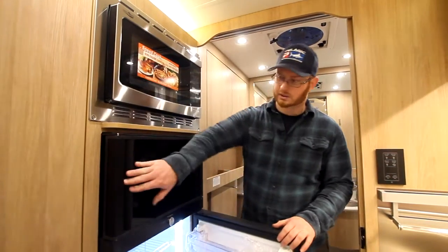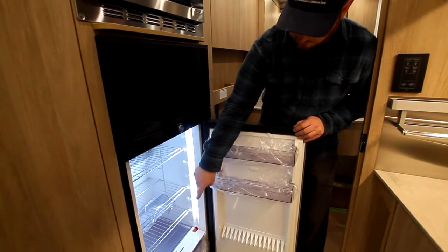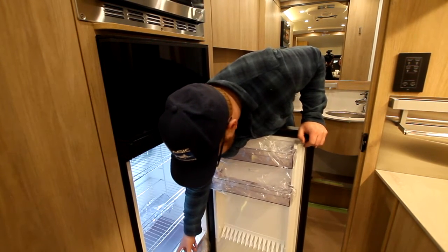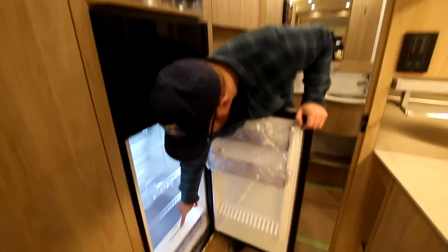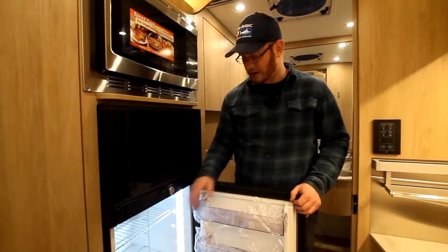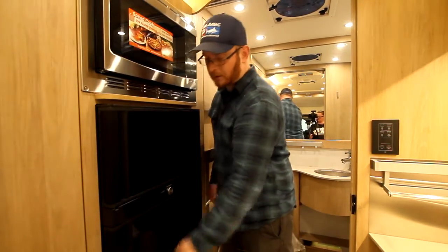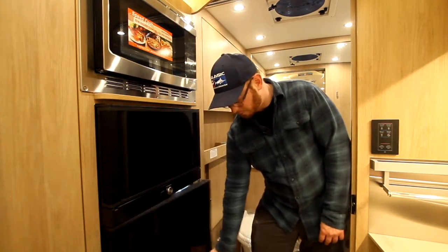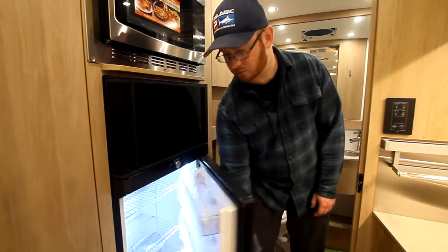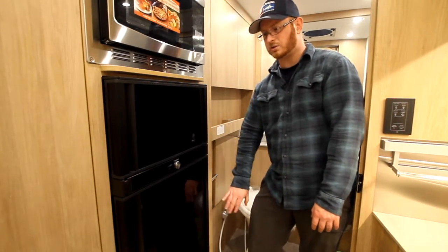You can see that I have the system on. You do have light indicators in it. You do have your fresh food selector down there, so you can control how much airflow gets into the unit right here. If you have pears, you want less airflow; if you have apples, you want a little bit more airflow. When pressing and opening this, you want to pull from the center and close from the center of the handle as well. That helps secure the top and bottom latches all the time. If you pull just from the top, you can run into an issue down the line where the door may flex or warp, preventing the bottom from being closed all the way.